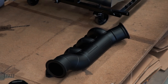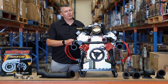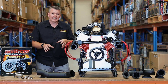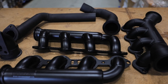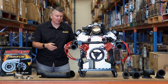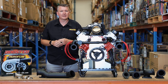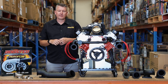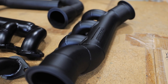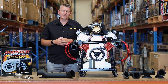The other option we've got, which we'll mount on the motor in a minute, is a single turbo kit. This is designed to mount on the passenger side of an Australian vehicle, or the driver's side of an American vehicle. Again, it's a builder kit. We've designed that log so that it will fit in a VE or VF Commodore — the downturn is angled so you'll be able to join the crossover pipe up and run it to the Australian driver's side. They also work in HQ, WB, and early Holdens. We have to stress these are a builder kit, so it gets you the starting point. You've got a three inch V-band on the front of the single that'll let you put your twist mount or up pipe for your turbocharger — V-band and T4 — or you can fabricate your own to suit whatever turbocharger you'd like.